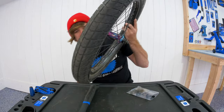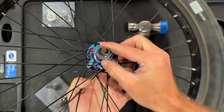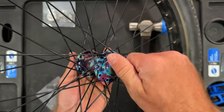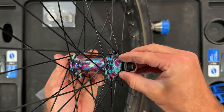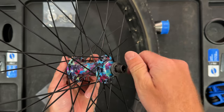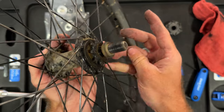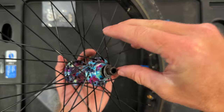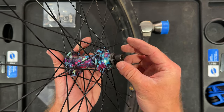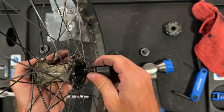The first thing we're going to do is take the front wheel and show you how to take the bearings out of a front hub. If you have a female hub, make sure your axle bolts are tightened in enough so that when we hammer on the axle bolt it's not going to mess up the threads inside the axle — at least halfway in. If you have a male axle, remove any hardware on the side you're hammering, and make sure your axle nut is tightened until the axle is flush with the outside of the nut.